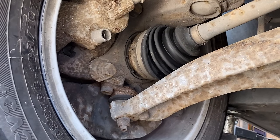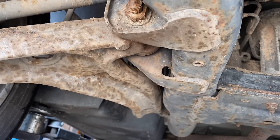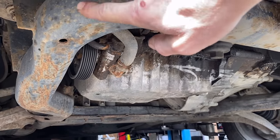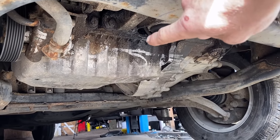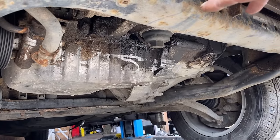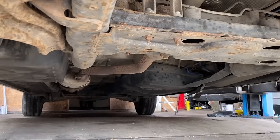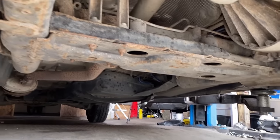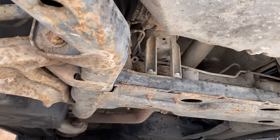Same story on the other side — CV boots intact, ball joint rubbers intact, apart from that front wishbone bush with a little bit of movement. There is absolutely nothing else wrong. If you were to replace all the bushes on this arm it's probably about £100 a side and it's really not too bad to do — one ball joint bolt, two spline bits holding the ball joint on, and rubbers front and back. The front subframe has little bits of corrosion but that's just where the paint's chipped off from stone chips — it's not rusty at all. There's a tiny bit of a weep around the oil filter area but that's just from people undoing the oil filter over the years. Sump is bone dry, gearbox is bone dry.